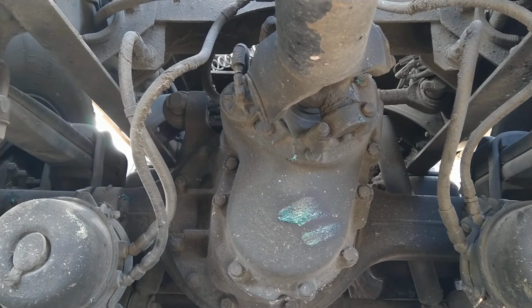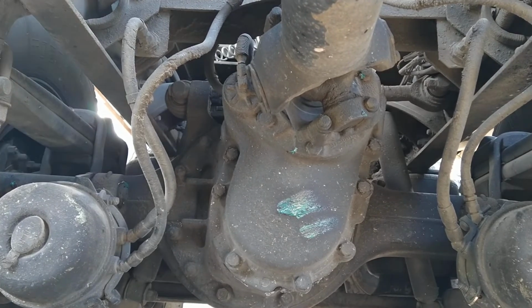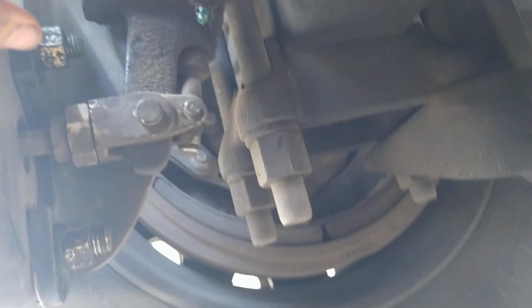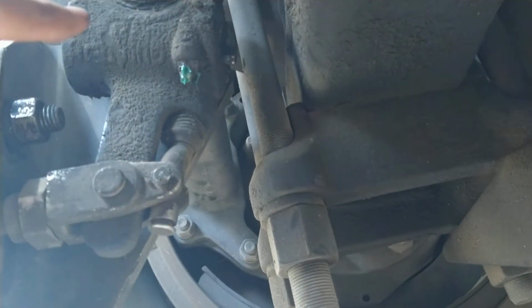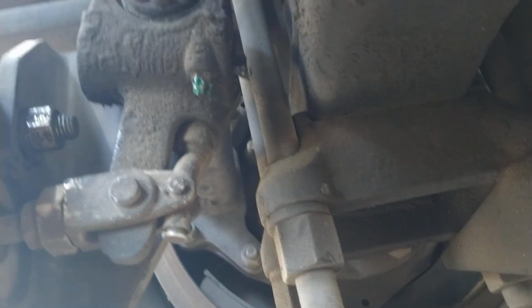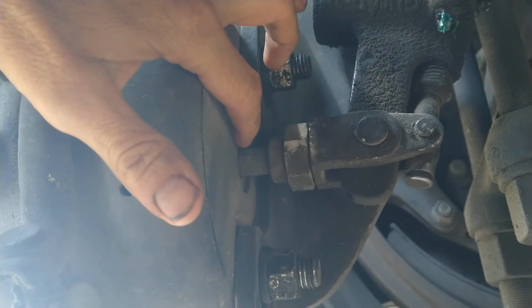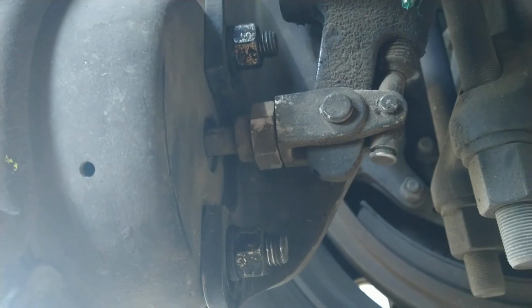And then I had to readjust all three, because sure enough, when I cranked down those slack adjusters here with the 7/16 socket and a long swivel head ratchet, 3/8 drive, they turned in further than I had backed them out earlier, because of the repositioning of the brake rod by moving these bolts up to where they actually belong.